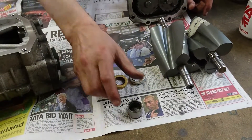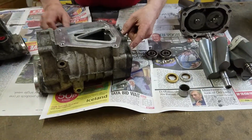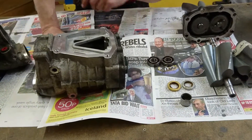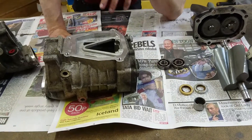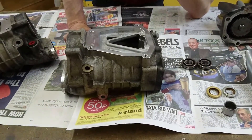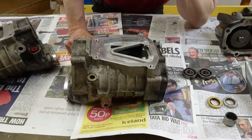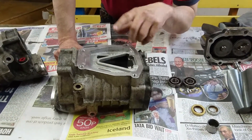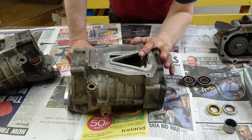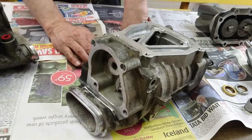The seals are a quite special type — not standard size or standard type, so you can't just buy them. These bearings are fairly conventional, though there is one special bearing here as well. If we do a rotor pack rebuild, we'll include supply and fit of our coupler on the front end automatically, and obviously we do both oil changes. It's a good time to do the supercharger oil change at the same time. We will do a free initial evaluation: a partial strip, inspect the nose, inspect the rotor pack for end float, and check the PTO end — certainly our most popular rebuild service — then advise you what you need.